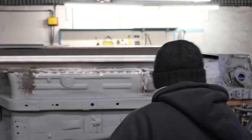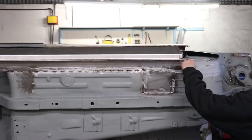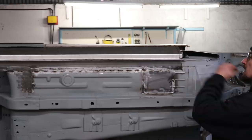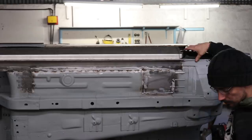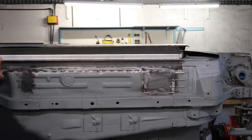Seal's probably half way done. What I'm going to do here is carry this lip on to about here, and then just put a plate flat across here. Where that line comes down, the wing wraps around, so I need to cut this off here and make a little return edge which I can weld all the way around this edge. Then we can have a flat here with some kind of mount — maybe just a bolt to bolt the wing on, maybe like a quick release pin — but super strong. I'll cut this off nice and level with a plasma cutter, trim it off, and then do another row of spot welds so it's super strong.